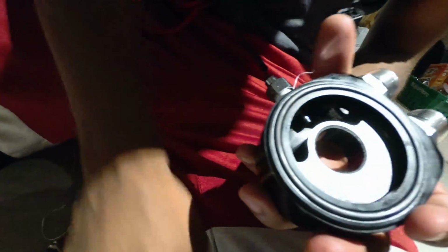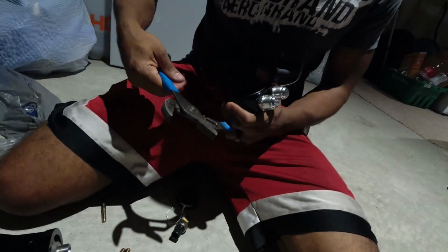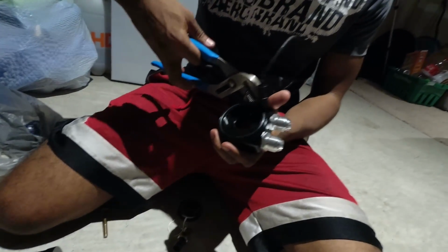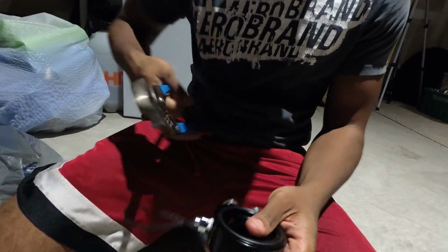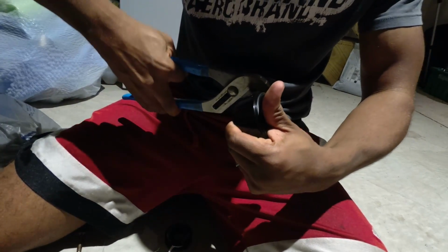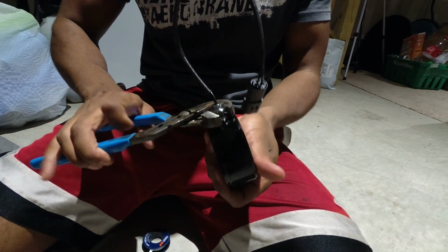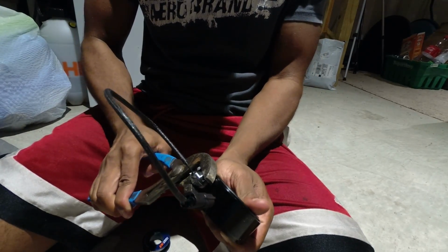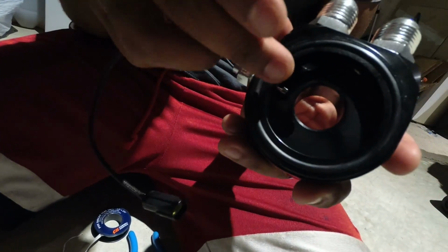That's exactly what it's designed for. And we're going to want to go ahead and take our wrench, and you can start tightening this down. One thing you've got to note is that you don't have to kill these ones on, but they do have to be tight so they don't back out and so that they seal properly. The Teflon tape is what's doing most of the sealing. So that's good. Perfect. More than enough. Don't worry about butting up against it. There's still going to be a nice little gap there.